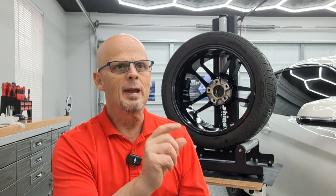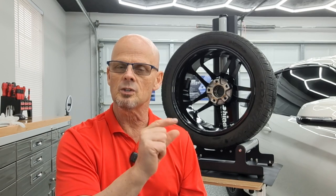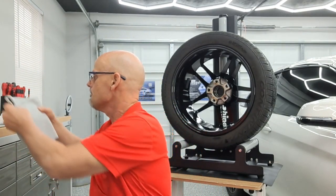You will notice that the more you wipe the surface, the brighter it gets, the more clarity that it brings to it. It's because you're effectively removing residue. A lot of times in ceramic coating applications that we see, there's a cloudiness that's left behind. Sometimes it's thought to be that maybe it wasn't polished adequately, but sometimes that cloudiness you'll see left behind is from residue that was not effectively wiped off the surface when the ceramic coating was applied. So we want to make sure that we tackle that.